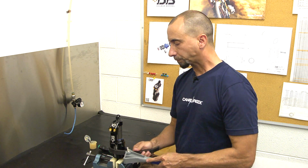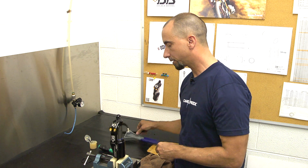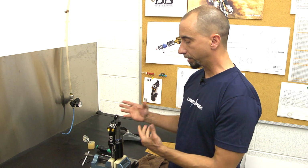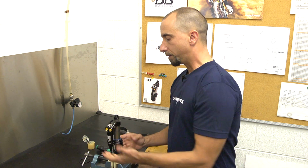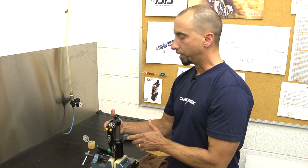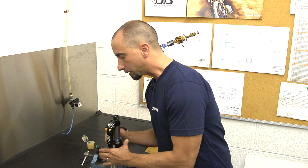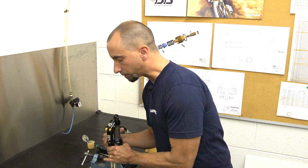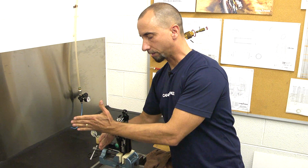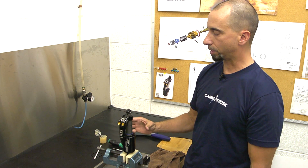Now at this point, you can clock your air can fairly easy because all the grease is on the O-rings. On a shock that's had air in it, it's more difficult to do this by hand, so you'll need to use the strap wrench. So if you know the orientation of where your air valve needs to be, left or right side of the bike, either at say 2 o'clock or 10 o'clock, if you're looking at a clock, this air valve now can be turned simply by hand because it's greased. I'm looking down. If I was looking at a clock, 2 o'clock's over to the right, that's where I want this air valve on this particular shock.